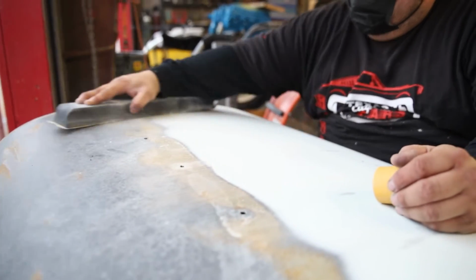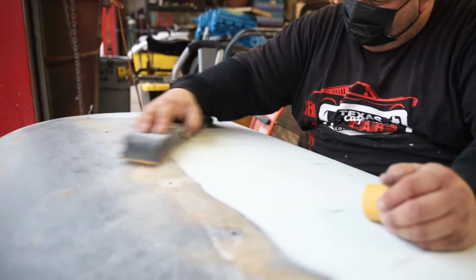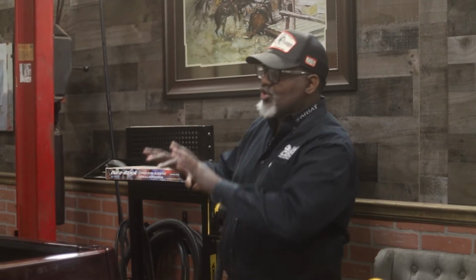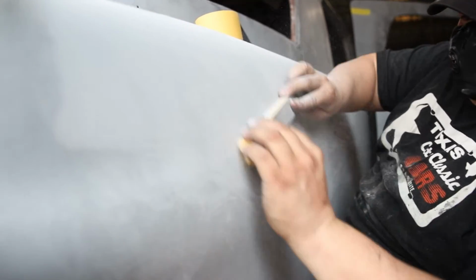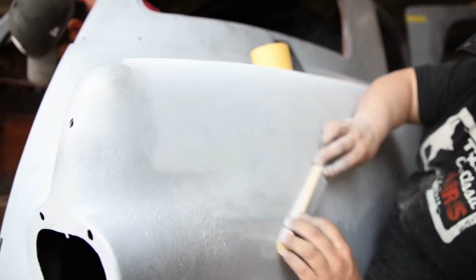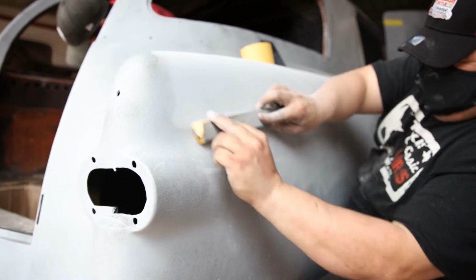That means by the time it gets to the block person, to your natural eye, the car looks beautiful. The car looks perfect. And so the blocking process goes, some people also call it tiger striping, or some people call it guide coat. But once you get to the blocking phase, now picture this car on a gray 2K primer. Car looks good. So what we're gonna do, we're gonna spray some paint, or there's some guide coat powder you can put out.